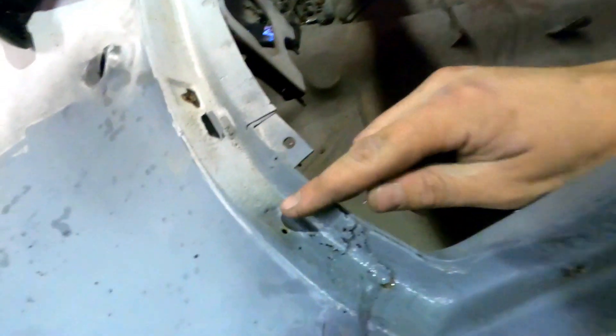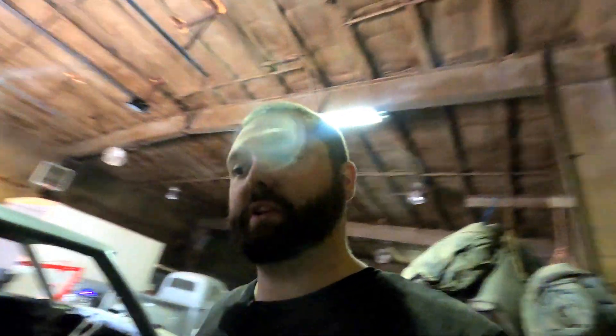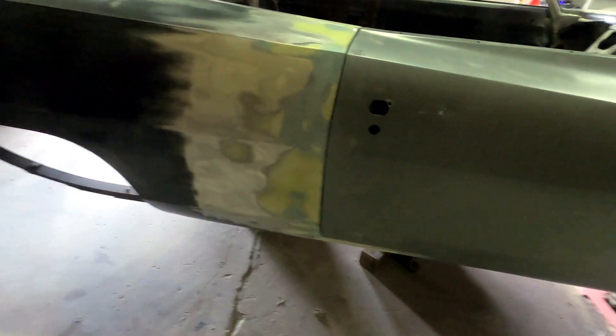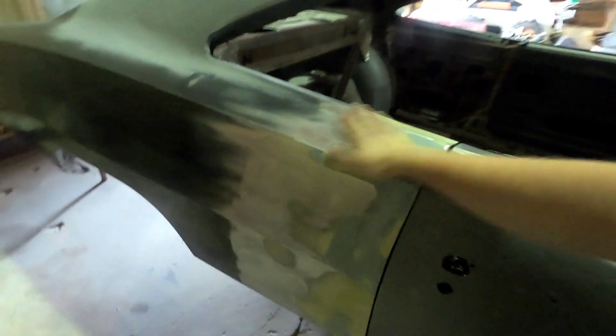All right guys, we're back, hopefully with no damage. Drilling those out was a great idea — hammering them, not so good. We got them all out. There's a whole bottom row, and the bottom one of each side were just kind of hammered and really rusty, so we drilled them out. I think it was like a 7 by 64, or 7 by 32 drill bit. We just popped them with a hammer and a screwdriver and they popped right out. We are going to paint this side of the quarter — we are ready to go for some primer. We still got some gap to fix up, going into the door metal a little bit so we can get a perfect gap, but other than that I think it's pretty good. I'm not the best person for filler, but it's working and it looks good.